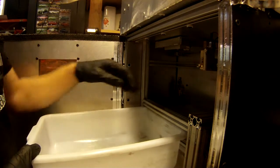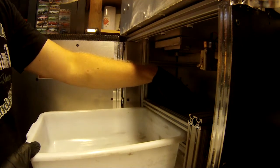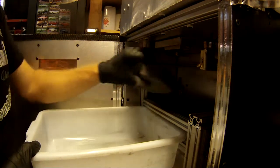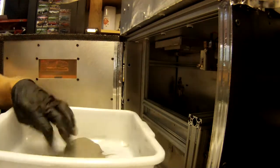I ran a few test prints to verify the dimensions were within specs. The job didn't take that long due to the flatness of the prints, but the c-clips did add to the project thickness. Thanks to the precision of the printing laser on this job, and also considering that I fine-tuned the laser settings, I was able to accomplish some very precise plastic thicknesses — like a 13 thousandths surface thickness and a 46 thousandths wall thickness for the c-clips — and it still retained its structural integrity. I was unsure this would actually work until I printed it, and I'm pleasantly surprised at how well it turned out.